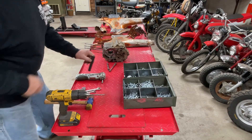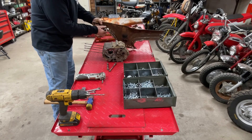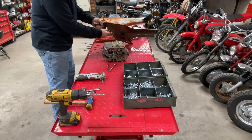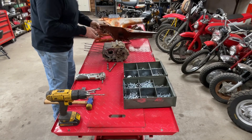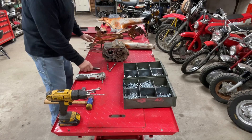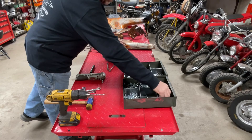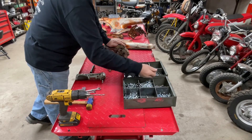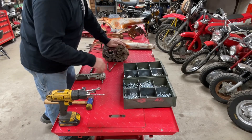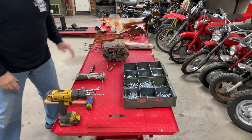This is going to be a tube — it spaces the frame the correct distance on the back. I measured the inside of another frame, came up with that, and that piece slides right over top of that. Then just miscellaneous — we're going to go with quarter-inch hardware and try and bolt it together. I know I should probably use metric since it's a Japanese bike, but this is what I have and that's what I'm going to use.